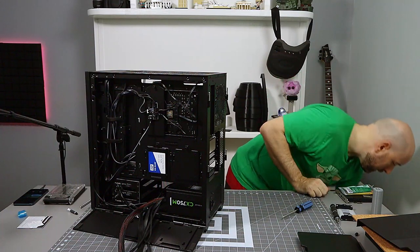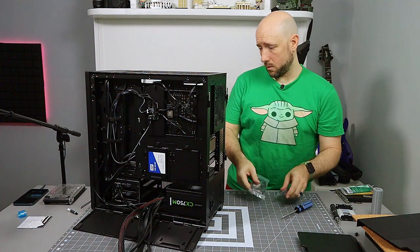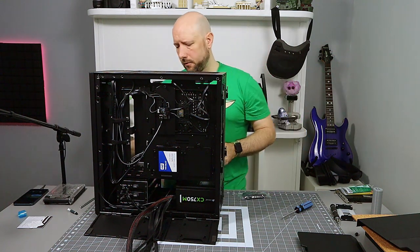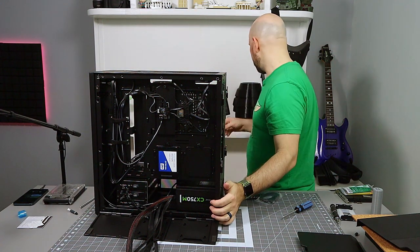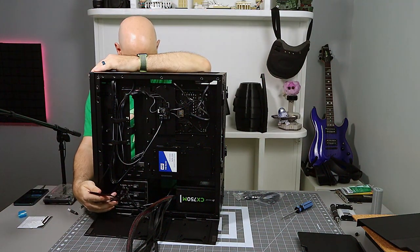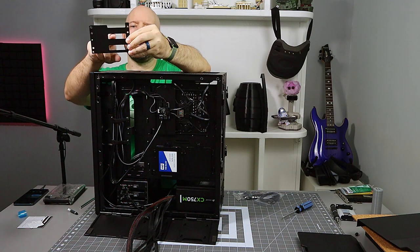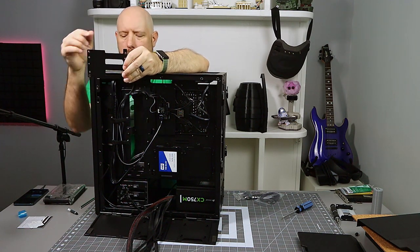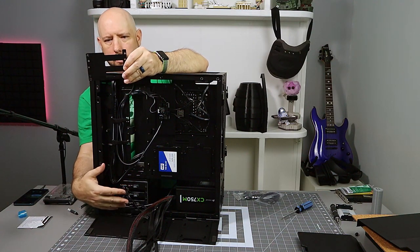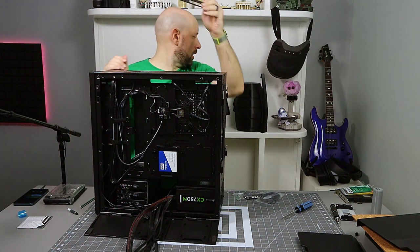All right, so what did this come with? Came with four. So I'll use the new SATA cables. So I'm going to need four. I have three in the hot swap bay. In this case, by default, comes with this blank back plate for the hard drive cage. And all it is cutouts. So when you slide a hard drive into the chassis, the SATA and power are exposed. The back plate has basically a SATA and a power repeater on the back plate itself. And when the drive slides in, it shoves into that repeater. So that's kind of the difference here.